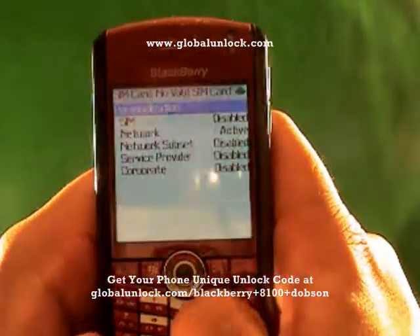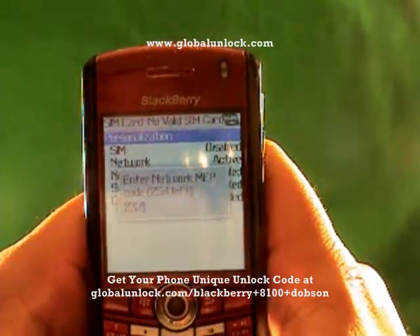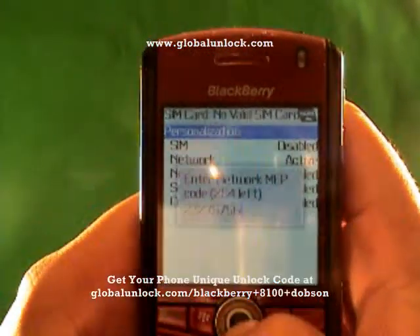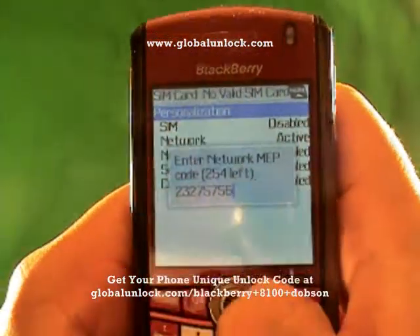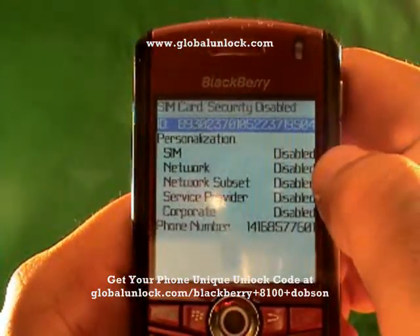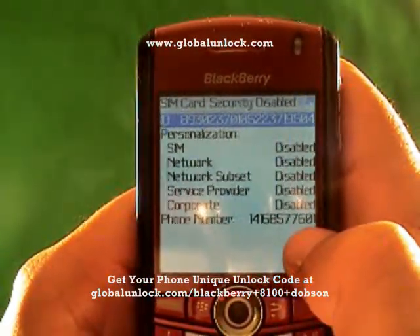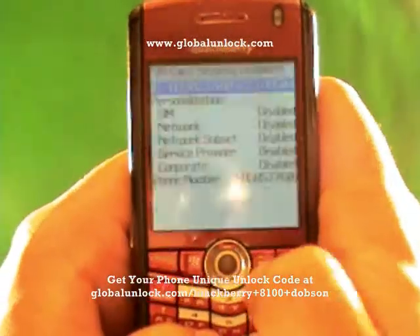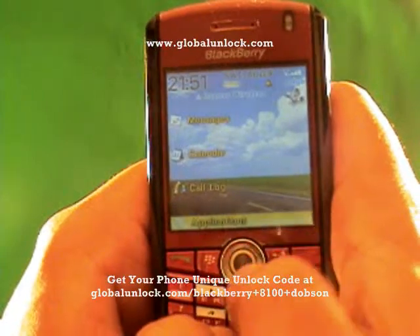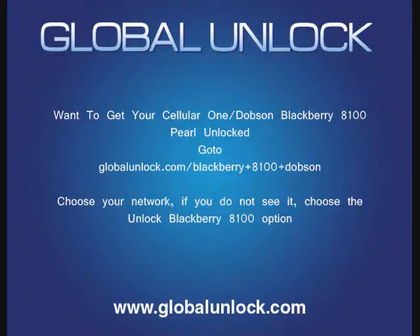Michael Edmund Peter Peter Alt-2, and I'm going to put in 2-3-2-7-5-7-5-6 — that is the correct unlock code for this phone. I enter it and hit the trackball. Code accepted! You'll notice it now says 'Disabled' here, which means the phone is unlocked. You'll also notice a phone number and that it now shows Rogers Wireless — so the phone has picked up the network. You can call 1-866-99-UNLOCK for support.